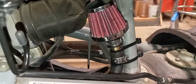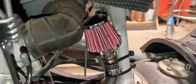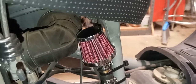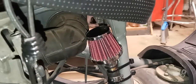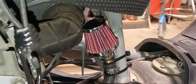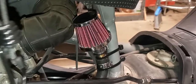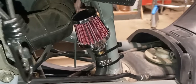I've already tested it for what it sounds like and feels like. When the filter's not on there and you put your finger over the hose, you feel a push-pull in exact relation to the engine RPM. I revved it to 5,000 RPMs on the center stand — it basically went back and forth. And then when you put the breather filter on there and listen with your ear, you kind of hear a hiss noise. And that's all I have as an observation.